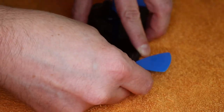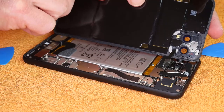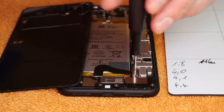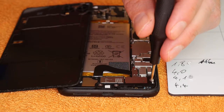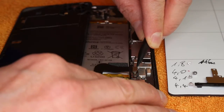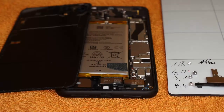Having freed the fourth edge, I can finally open the back side. But be careful — there is still the cable to the wireless charger. Before continuing here, I unplug the old battery. Its connection is behind a clip, which is fixed with four screws, which are all different. I park them on a magnetic plate, which is really helpful to keep things in order during the operation. Finally, I can remove the clip and unplug the battery. I always apply force from the side of the plug and not from the middle — it could jam and break.